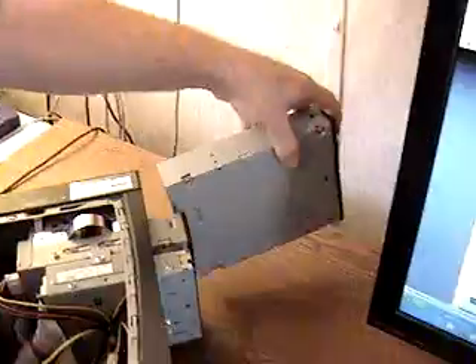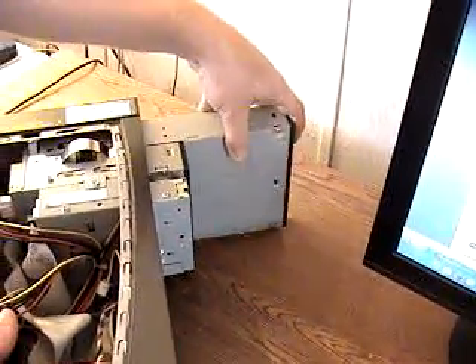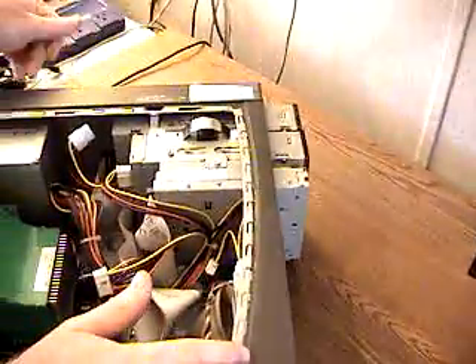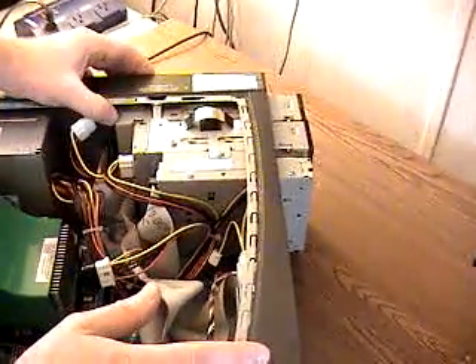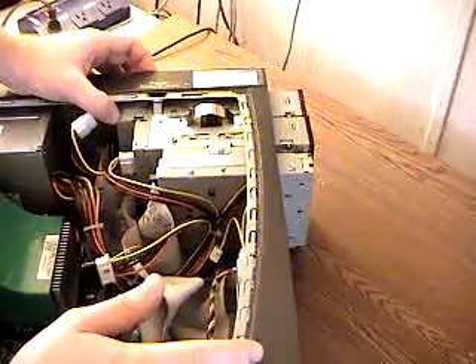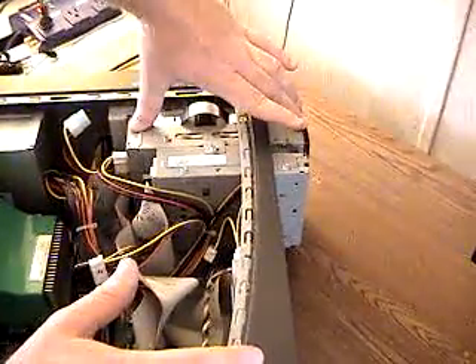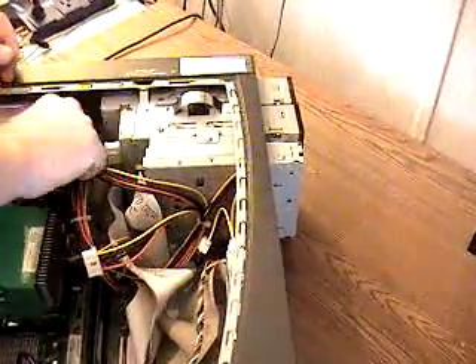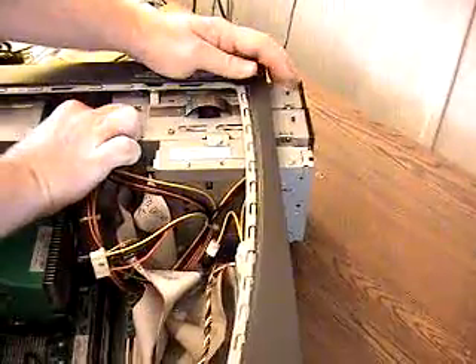You would take and insert your new drive. Also take note of the color of your case, and in some cases the drive might be too long if you're dealing with a mini ATX case — you'll have to get a shorter drive and be sure to purchase the right kind of drive. You'll properly jumper the CD-ROM drive.